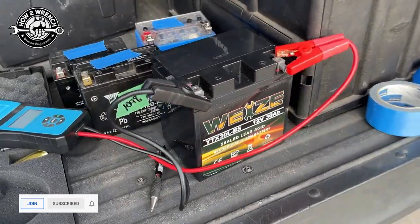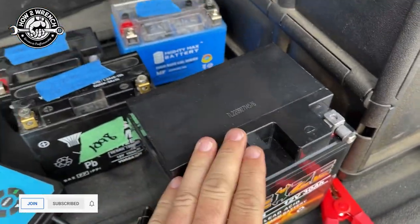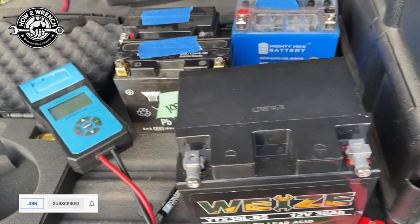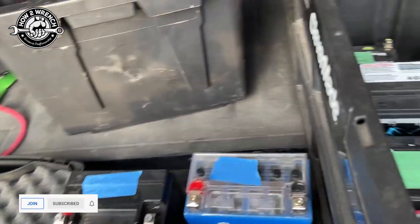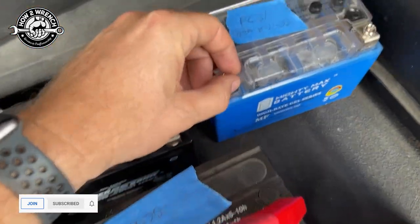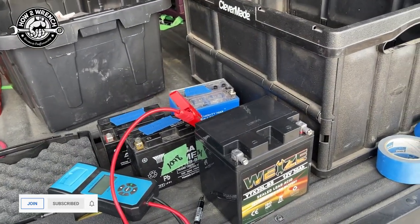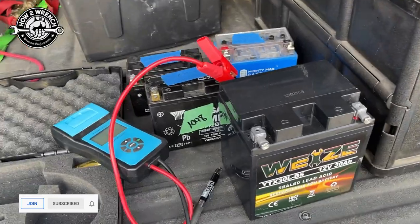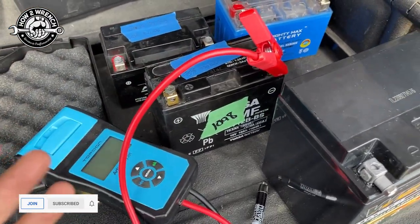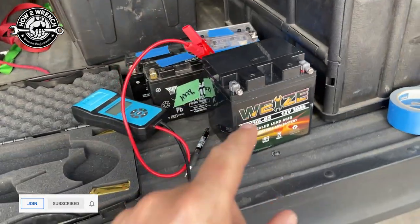So what's the lesson here? The lesson is that the integrity of the connection of the tester is just as important as there being a bad connection in the battery. I'm going to be honest — I think that I may have taken that for granted on a few of these, just throwing it on there. Maybe I was getting lucky and getting a lot of really good results. You just crank it on here and you get a pretty good bite. So I wouldn't jump right into junking your batteries. Like with all my other test videos on electrical, I say you've got to do this one thing: if you ever get a bad result, retest. If you keep getting bad results, maybe if you have a couple different meters, go ahead and check it against a good known meter. This was super rad to catch on video — that the tester would deem this bad when it was all human error in how you hooked it up.